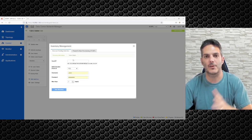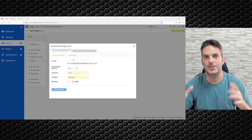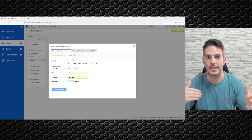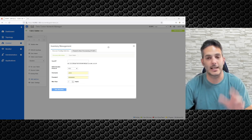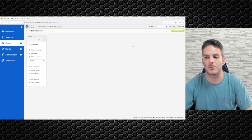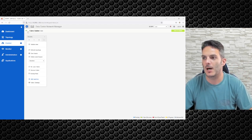and you'd be able to do the LAN Classic config, which if I remember correctly, if you're not doing VXLAN fabric connectivity with everything, because there are certain cases where you're not going to want to extend the VLAN and stuff like that, you would want to do basic stuff like that. Again, something I have to test out. I'm not an expert in DCNM or Nexus Dashboard, which is the 12.0 version of DCNM.